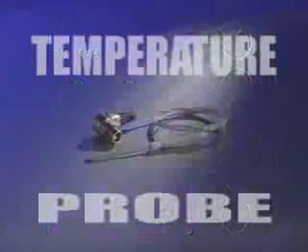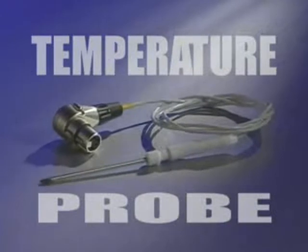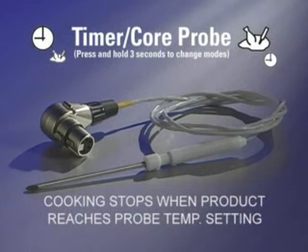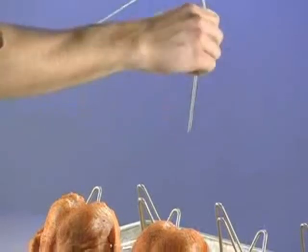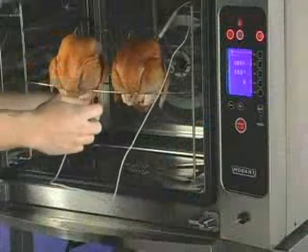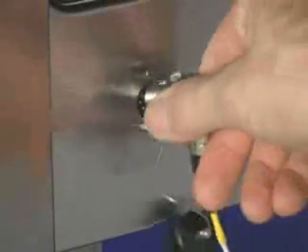It is possible to cook with a temperature probe. The probe temperature defines the final temperature of the product for any cooking phase. The oven cooking cycle stops when the product temperature reaches the probe temperature setting. Total cooking time is not known or entered when using the probe. To use the product temperature probe, insert the pointed end of the core probe into the product so that the tip is approximately in the middle of the product to be cooked. Load the product into the oven. Run the probe cable out the side of the door opening and close the door.